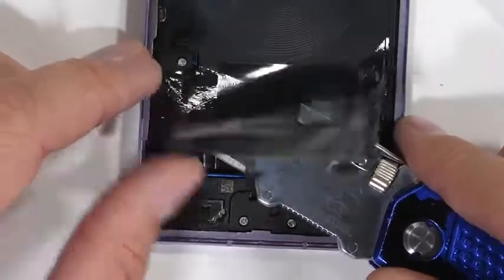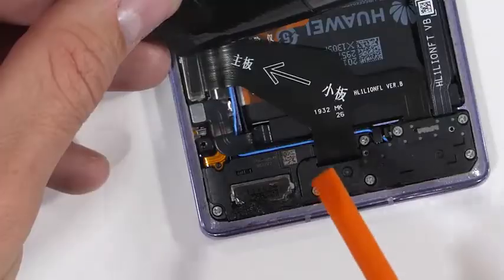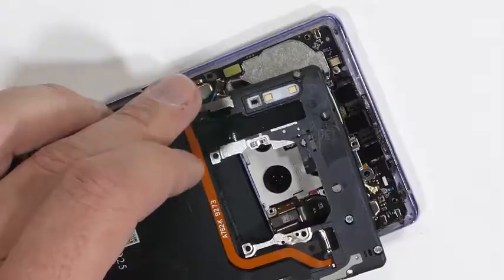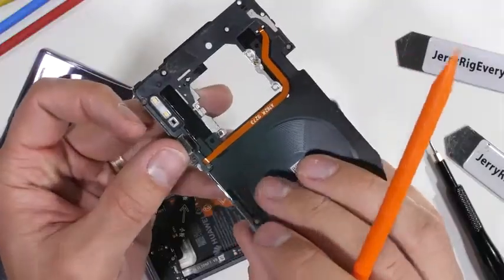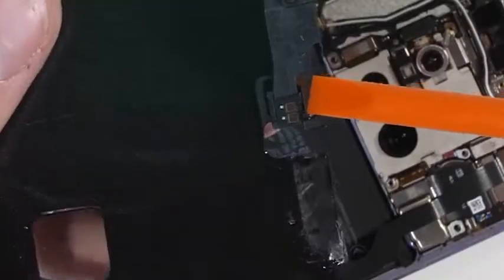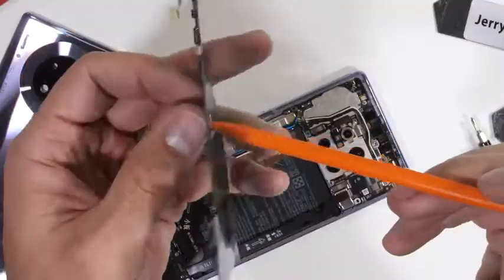There is a small plastic chunk underneath the little flippy loin cloth which sits over the battery connection. I'll slip my pry tool in here and unclip the battery like a little Lego, then finish removing the rest of the rear plastics and unplugging the dual LED flash ribbon that's also connected to the motherboard. This wireless charging coil transfers power with the two little contact pads on the back, and can wirelessly charge at 27 watts and do reverse wireless charging to other devices.